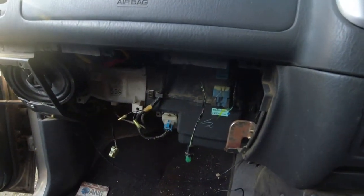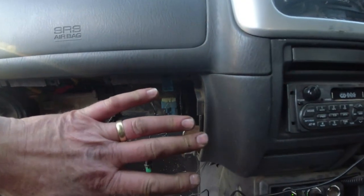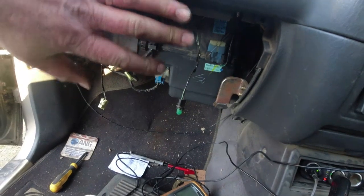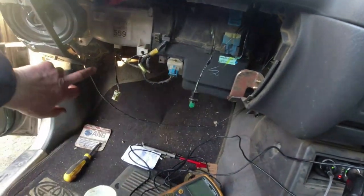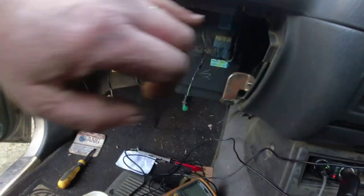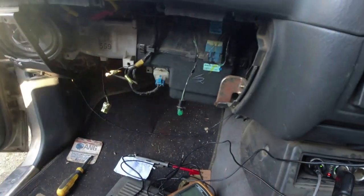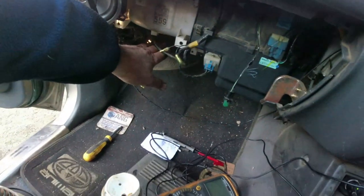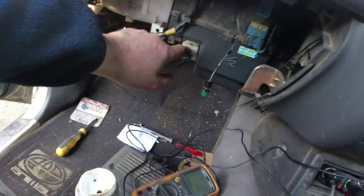So I have been right through this thing. All of the blower and the resistor are located underneath the passenger side of the dash. You undo nuts at the bottom, four screws on the top, and then the whole glove box comes out — gives you really good access, dead easy. The blower motor goes here and that's the resistor, that little bastard there.